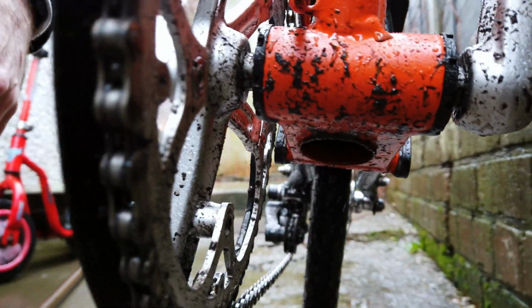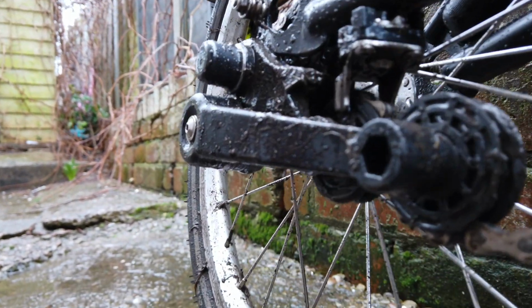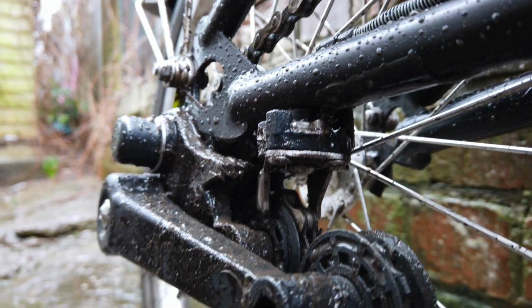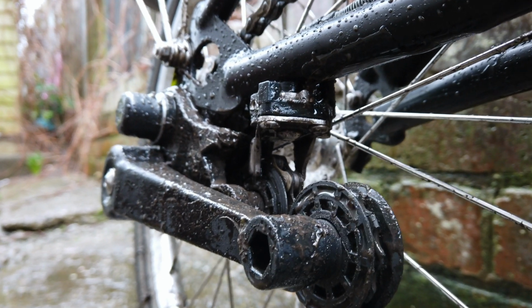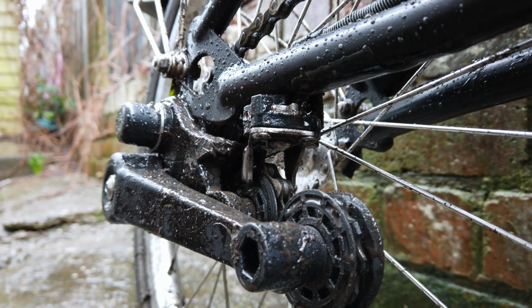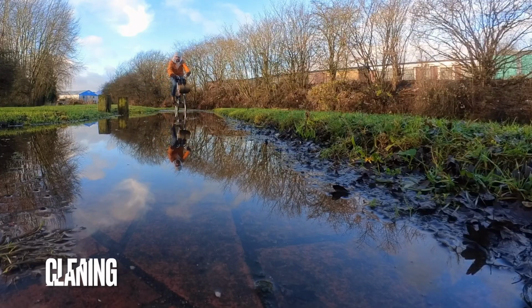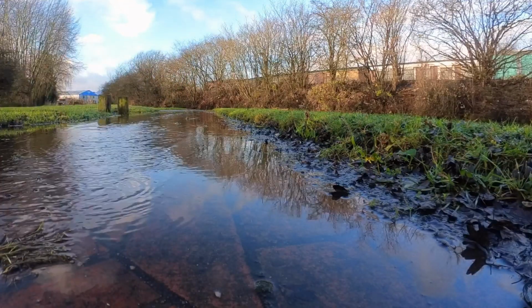The reason I bring this up is that I have had a couple of occasions where the gear would not change due to bits of dirt and leaves along the cycle path blocking the chain pusher assembly and not allowing it to move freely. In order to sort the issue out, I have just had to remove some of the dirt from it and it works fine again, but I have never had this problem on the 3-speed due to the internal hub.